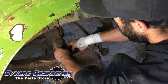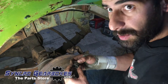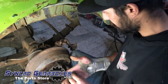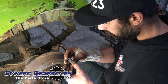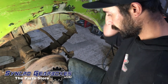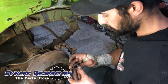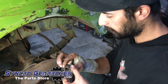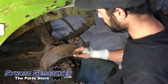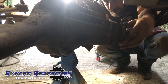The front end was really bad — check out these springs. What should have been one spring is now just three washers, which explains the massive amount of movement. Obviously this will get fully rebuilt anyway, but it does explain why it was so knackered. You can also get a conversion to get rid of these springs and fit a solid pin like the Series Twos, which we'll probably end up doing.